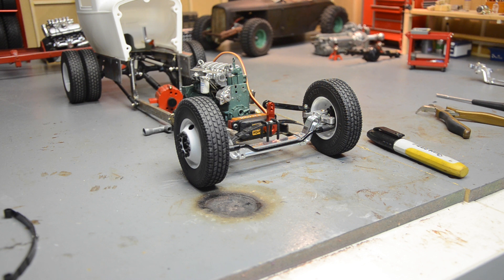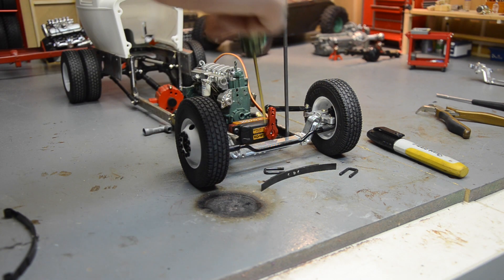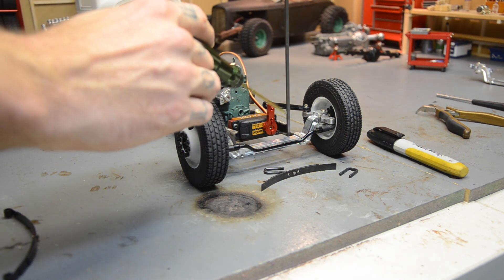I've done a few marks here. I've got this tiny tiny square tubing — it's actually square rod, not even tubing. I'm not sure where I got it, probably Home Depot. I'm going with something small like this hoping I can put it in the end of the frame rail and braze it to both the upper and lower part of the C of the rail, and also the side, braze it from the inside. I can angle it forward because there's limited space — maybe a little more than a quarter inch between the end of the rails and the back of the axle.